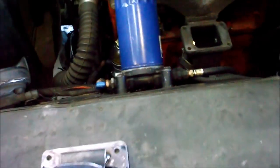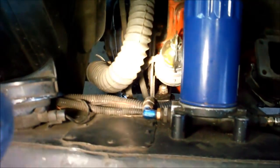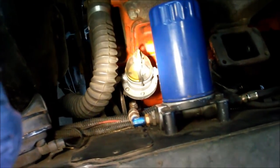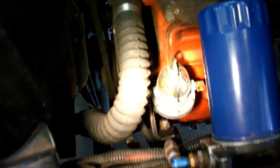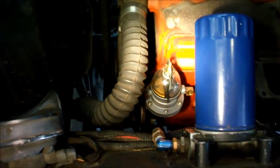I also had to put a new fuel pump on last week - it was leaking out the bottom. It was cheaper to get a new pump than a rebuild kit, so I went with the new pump. I had to sand down the glass fuel bowl because it wasn't sealing - they didn't cut it well.